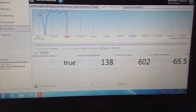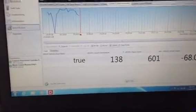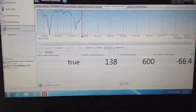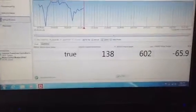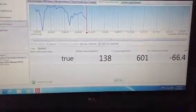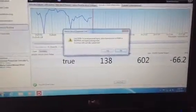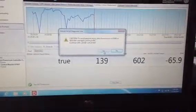Now we're going to press run the test. Right now it's showing a set of cylinders in firing order. The firing order is 1 and 5, 3 and 6, 2 and 4 — those are the companion pairs of the firing order. The truck is at idle at about 1000 RPM, and it will be cutting out one cylinder at a time to check and make sure all the injectors are working fine.